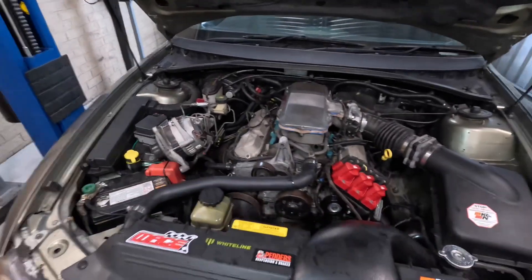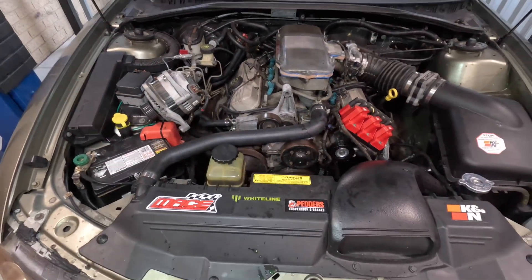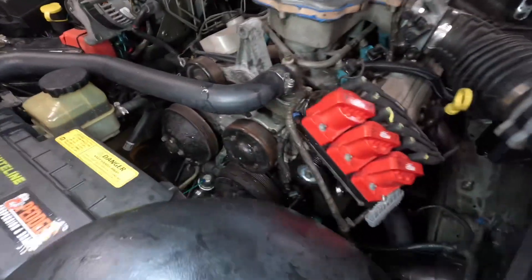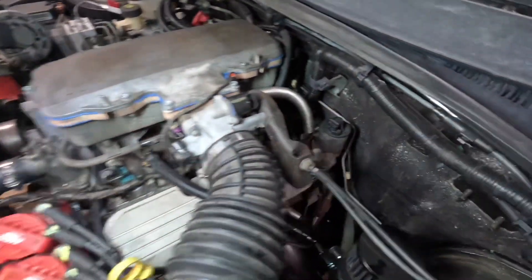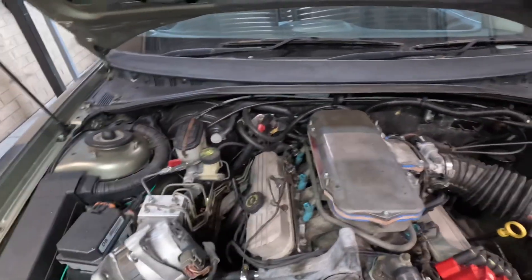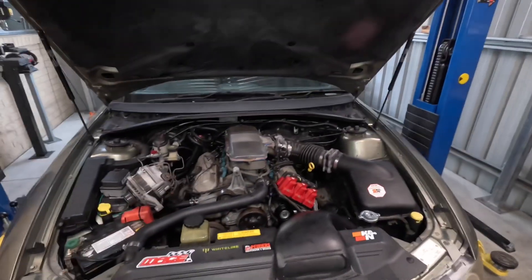I've jumped ahead a bit as I often do and I've undone everything on the engine that's related to wiring. I just have to go underneath and do the knock sensors and the transmission wiring, but literally wherever there is a plug, just disconnect it. So everything on the throttle body, the injectors, crank and cam angle sensors, coil packs, coolant temp sensors, earth wires on the back of the motor, oxygen sensors for the exhaust, EGR valve, purge valve solenoid - all that stuff's been disconnected. I'm going to lift it up in the air now, undo everything from underneath, and then drop it back down and get inside the car.